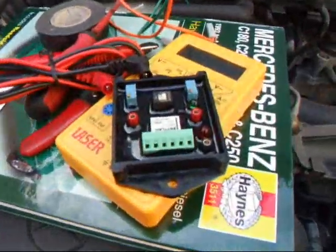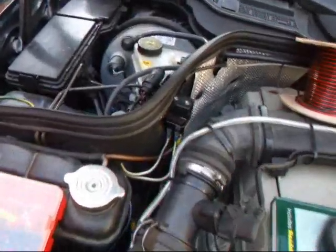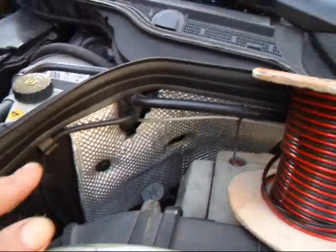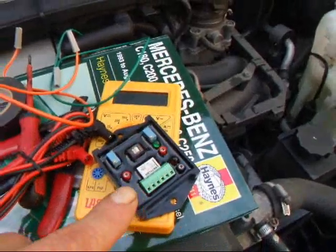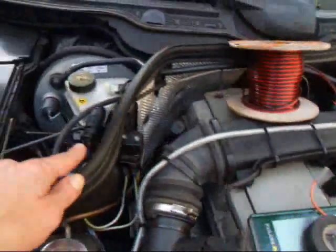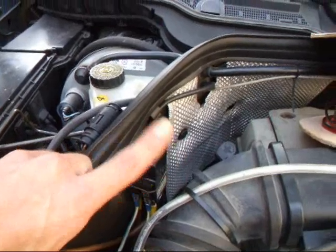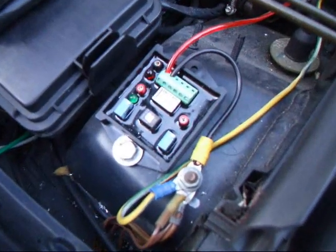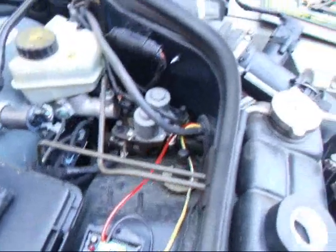This is from fuelsaverMPG.com or similar. There's the lambda wires coming in - the lambda sensor is right down there. This is the wire coming from the lambda sensor. We thought we had two lambdas so we got a dual adjuster, but it only needs one. Luckily the relay is there, so when we turn the hydrogen on and off the lambda adjusters will go on and off. There's the EFI earth, there's the live - the red wire joining the live, that turns on the relay. Job's a good one.